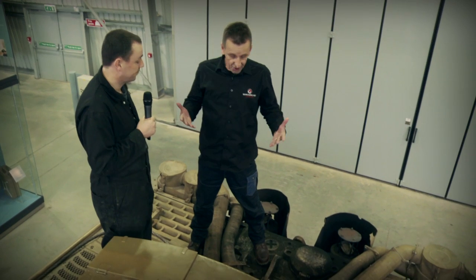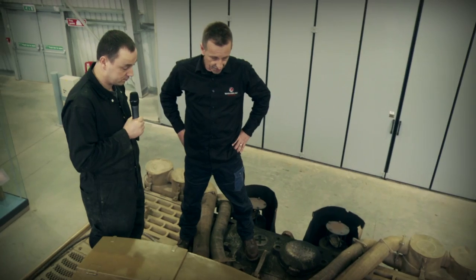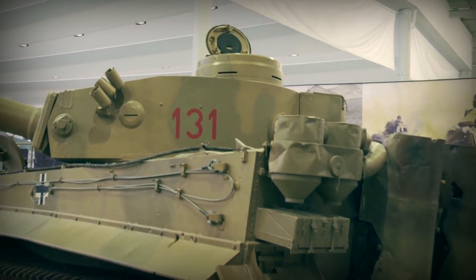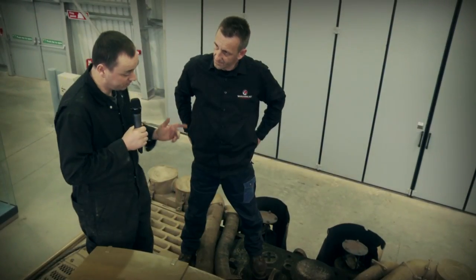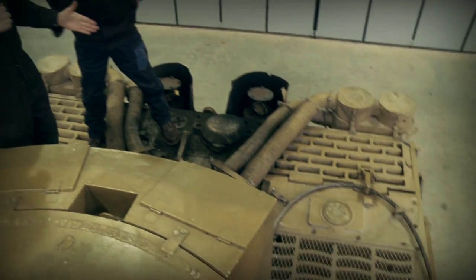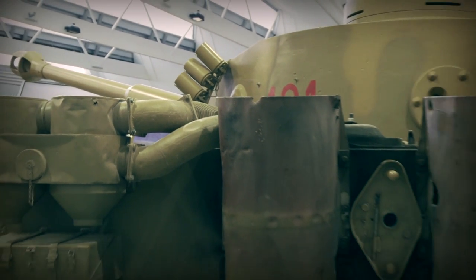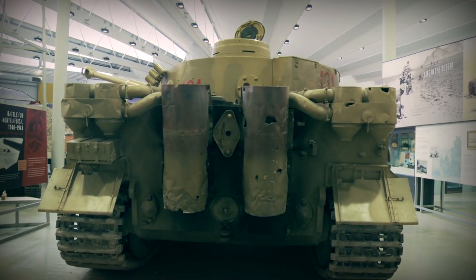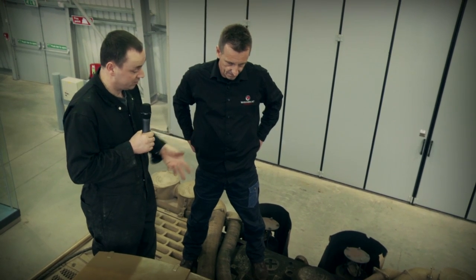We've now moved up onto the back decks and Ian's going to give us a quick rundown of what we actually do on the first parade up there. Within the engine compartment there are more or less three main things to check. We've got what's called the fan drive gearboxes — one located on the left side, one on the right side. They have oil in them and dipsticks, so they'll be dipped and checked when stationary, and also when the engine's running and the fans are engaged.